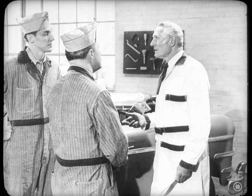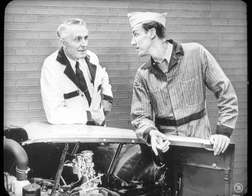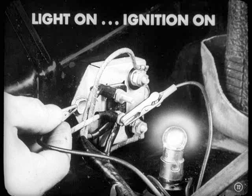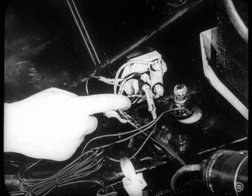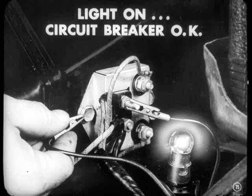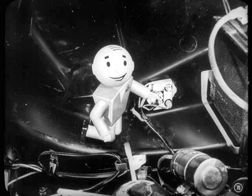Now let's talk about downshift difficulties. If a car won't downshift, you'd look for troubles just opposite to upshift troubles. After first checking throttle linkage operation, connect the test light between the coil side of the circuit breaker and ground. If the light went on with the ignition on, you'd know that current was getting through to the circuit breaker. If the light didn't go on, you could figure on a loose or dirty connection or a break in the wire leading from the coil to the circuit breaker. To check the circuit breaker itself, hook up the test light between ground and the solenoid lead terminal on the circuit breaker. If the light went on, you'd know the circuit breaker was okay; if not, you'd have to replace it.